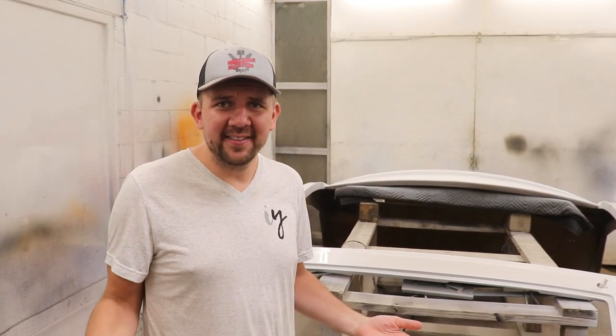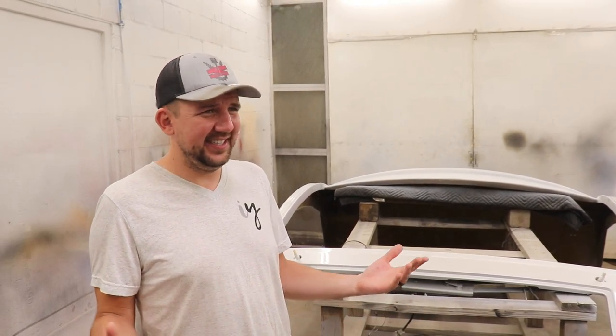I mean, it's pretty crazy. We got two coats of base on there, and then two coats of the white, and then four coats of the pearl, and then two more coats of clear. That's like 2, 4, 6, 8, I don't know how many bases, you know? Four stage kind of thing as compared to the single stage that they used to do, just paint clear one time, that's it, they're done. So definitely putting a lot more into it for the paint job.